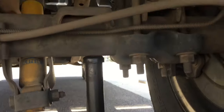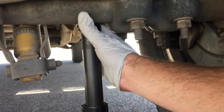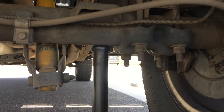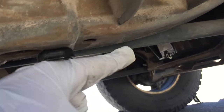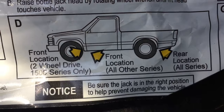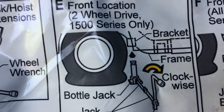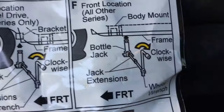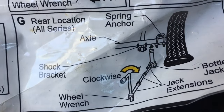Next, take the bottle jack and extend it until it's touching. Where they want this is between the shock absorber and this bracket here — right there on the axle. Make sure it's centered; feel it on both sides and get it as centered as you can. Turn it clockwise by hand as much as you can until it's touching. If it's the front of the vehicle, you're just going to do it on the frame — same thing, turn it clockwise until it touches — right on the flat part of the frame. There is a diagram showing this for two-wheel drive, which is a little different. For four-wheel drive you're just placing it on the frame. Two-wheel drive and four-wheel drive have a small difference, so review the instructions if you have the two-wheel drive.